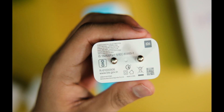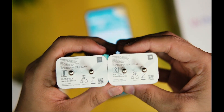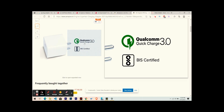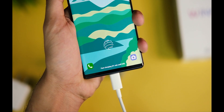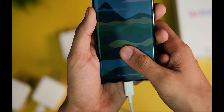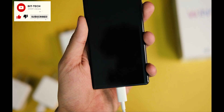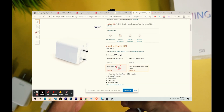Next up I tried this Quick Charge 3 compatible charger from the Redmi Note 9 Pro Max — it's a 33W charger and you can see the QC3 logo on it. It supports Quick Charge 3, and if you want 18W fast charging on the LG Wing you can use this adapter. This Xiaomi charger charged the device really quickly — around 10% in 10 minutes, so a complete charge in almost 100 minutes roughly. It's also totally safe as the device officially supports this charging standard, and you can get the same charger from Amazon or the cheaper 27W one for only around 549 rupees.